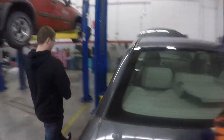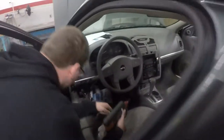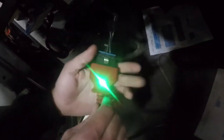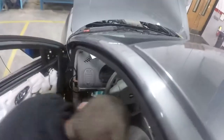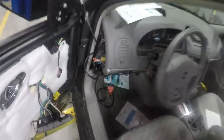Go around and find that 16-pin connector and plug it in. It's hanging down because we put the trim down. You're going to roll it outside the window and lay it up on the windshield, then turn the key forward to the on position. Then close the door so we don't drain the battery.